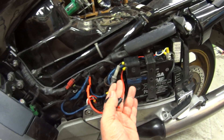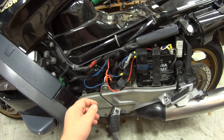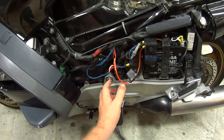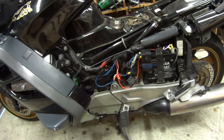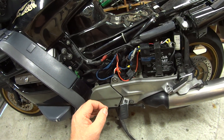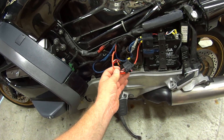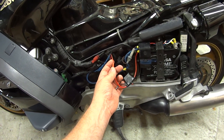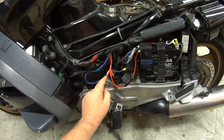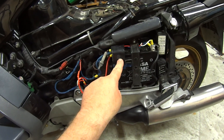The solid red wire — I've given it its own 30 amp fuse and connected it directly to the battery. Since doing this, the bike does not fault under heavy acceleration anymore. It removes that load from going through the relay, with no detrimental effect. Both the ST Owners Forum and ST Rider Forum recommend what they call the 'red wire bypass.' It's as simple as removing the solid red wire from the loom, adding a 30 amp fuse, and connecting it directly to the battery positive.